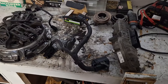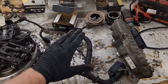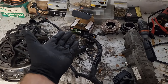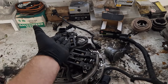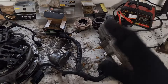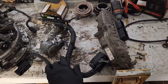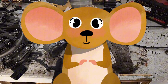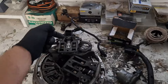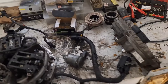Just a basic overview recap: if you have a clutch position sensor fault code, it's usually a bad actuator. I would replace them both at the same time and get OEM actuators only — I'll put a link below. To confirm, swap the actuators top to bottom, clear codes, and see if the same code comes back, or if it switches from a clutch A position sensor circuit to a clutch B position sensor circuit — then you know the actuator is bad because that's the only thing that changed. If the code doesn't change, pull the air box out and look at the grounds. Make sure they're tight and not dirty. Visually inspect the harness and replace the TCM if the harness is intact. Also do a clutch fork test on whatever clutch the code references.